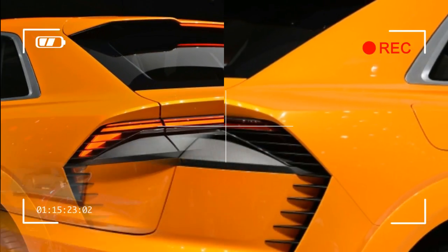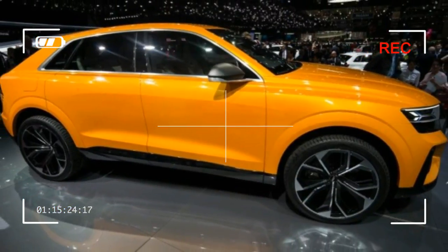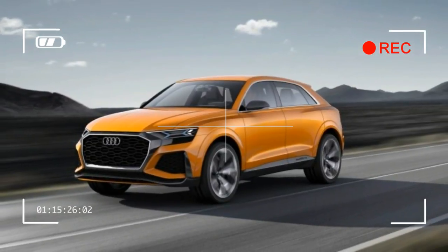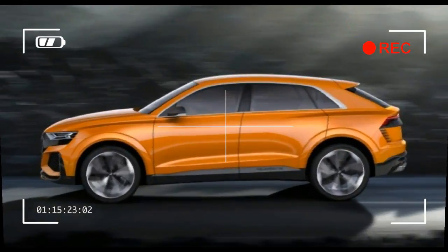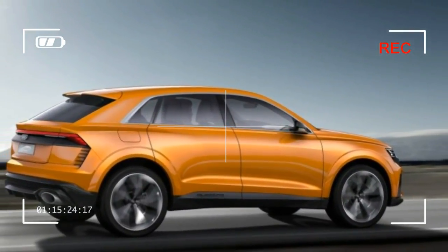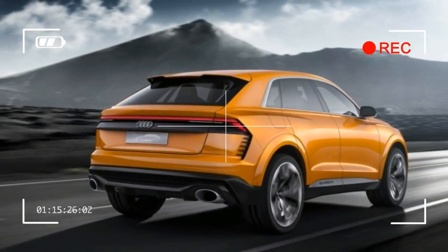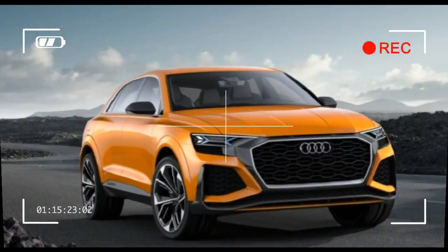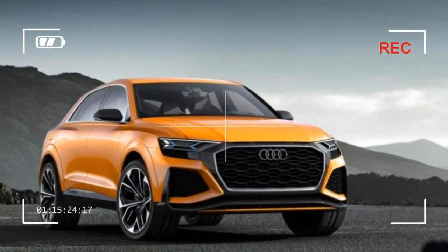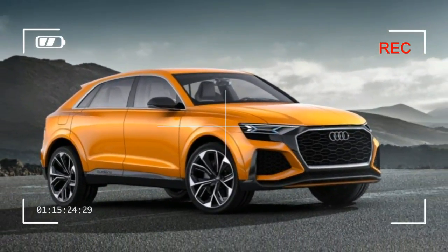This technology is better known as an e-charger or electric supercharger, and it's something Audi has been pioneering for a few years now. After gracing RS5 TDI prototypes, the trick is in production on the European market SQ7 diesel SUV. Between the electric motor generator in the transmission and the e-charger boosted V6, the Q8 Sport's powertrain packs 476 horsepower and 516 pound-feet of torque, matching the plug-in hybrid Q8. The electric motor contributes less than 30 horsepower.